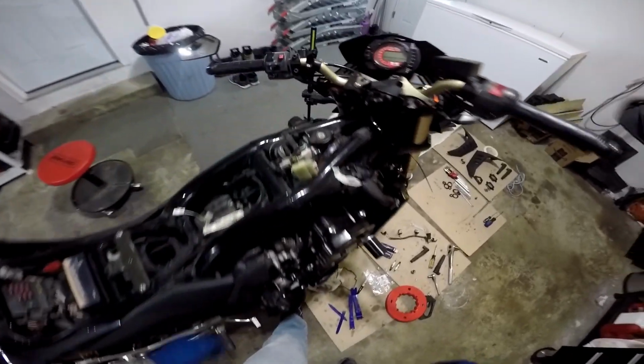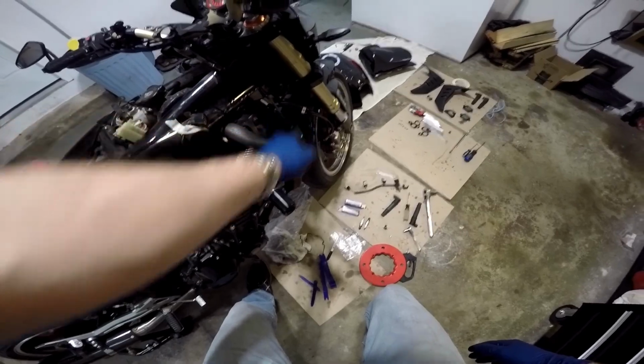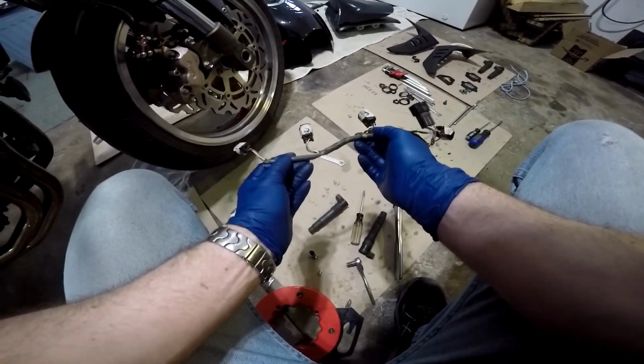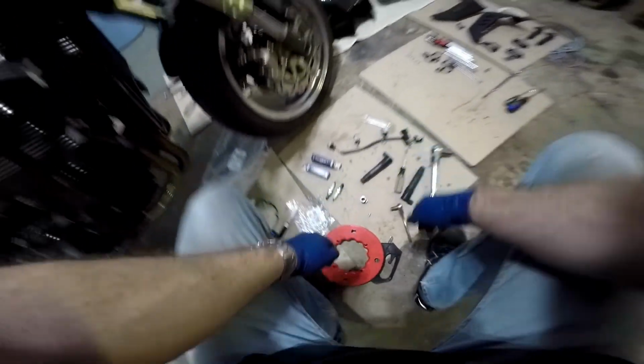Two big things: make sure you bolt that thermostat back down, and make sure you bolt your radiator back where it was supposed to be. When you put your spark plug coils back in, just make sure you get the numbering pattern correct for the firing pattern for your cylinders. I will show you guys this because it is really difficult.